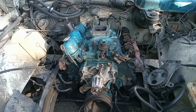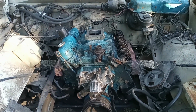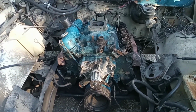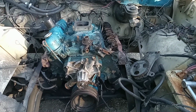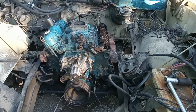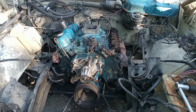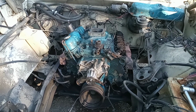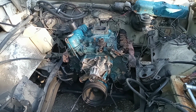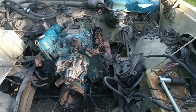We're going to go ahead and throw the top side together. Valve cover's off so I could find top dead center, because when I pulled the distributor, I thought this motor was bad, and I really didn't care. So got that found. I like to work back to front on these when I put them together, opposite of when I take them apart. Just makes things easier, I guess. You can get to the back stuff and then work your way forward.